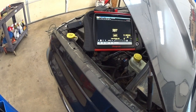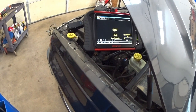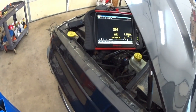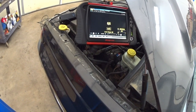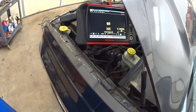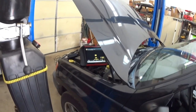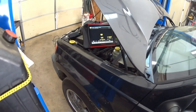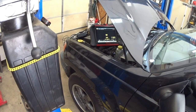I already found a switch with a problem — that is the power seat on the driver's side. You can see it's 15 milliamps over the threshold. So 50 is normal, and everything over 50 is drawing power out of the battery. Let me continue switching stuff here and go from there.